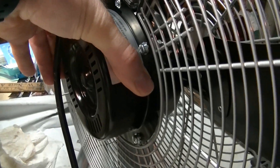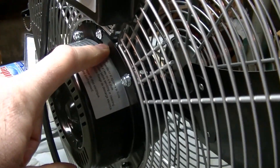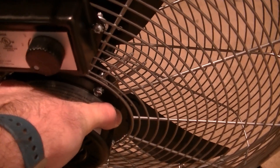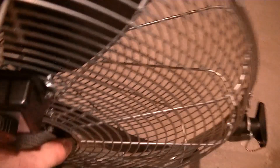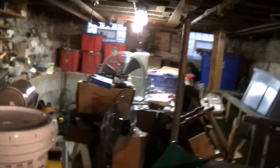That's obviously because there's much more of a load on this motor than on the other one, because the blades are steeper pitched. The area where the stator is is pretty warm. They do get a little bit warmer when you turn them off just because there's no air flowing over them. This other one right here is definitely a little bit cooler. I don't know if there would be this much of a difference if I was running both of them on low — I'm sure this one would run quite a bit cooler on low.